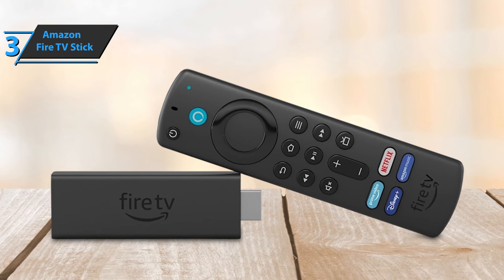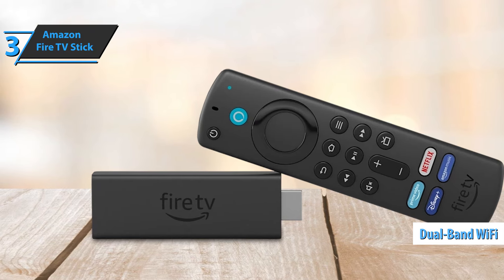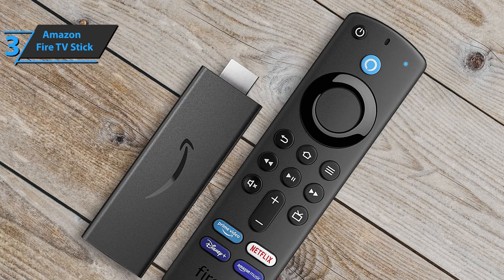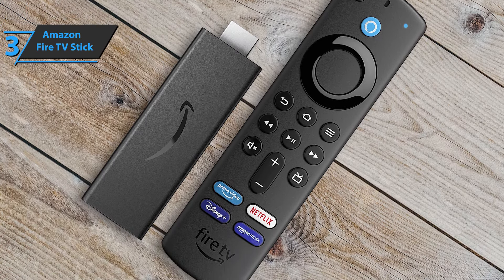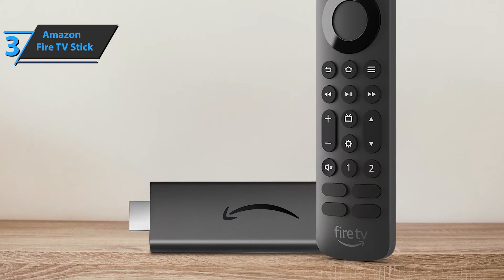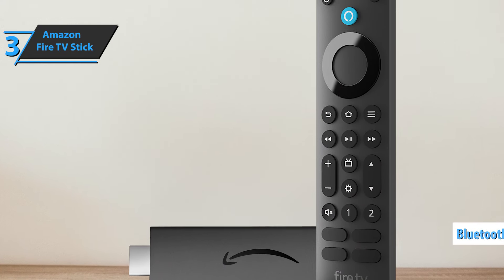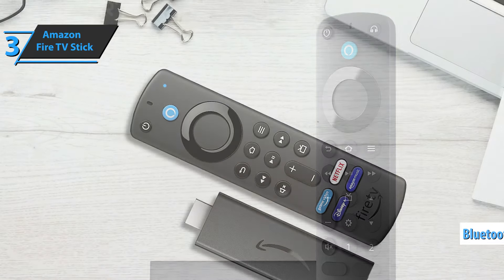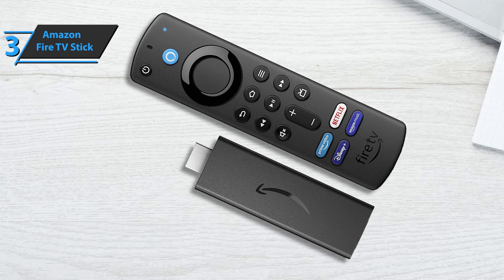For wireless connections, there is Wi-Fi AC dual-band 2.4/5GHz 2x2 MIMO for downloading or watching live or on-demand content. It has good range of coverage and enough bandwidth for 4K resolution, though we always recommend using the 5GHz band to avoid problems. There is also a Bluetooth 5.0 LE connection for pairing with other wireless devices such as speakers or soundbars, as well as an infrared sensor for remote control.